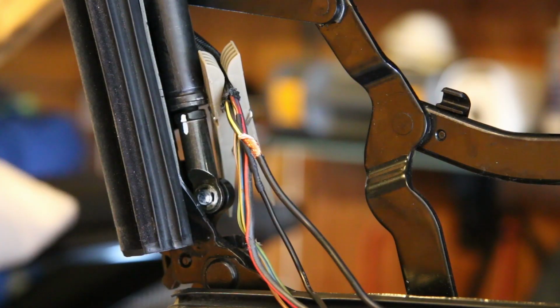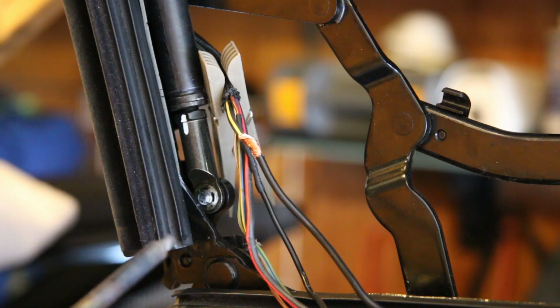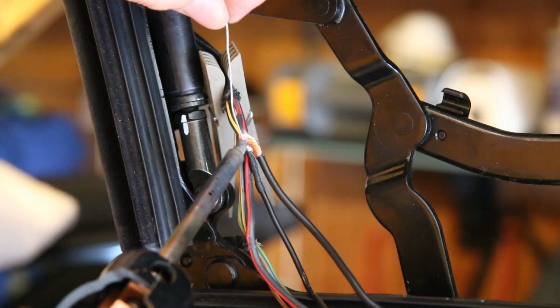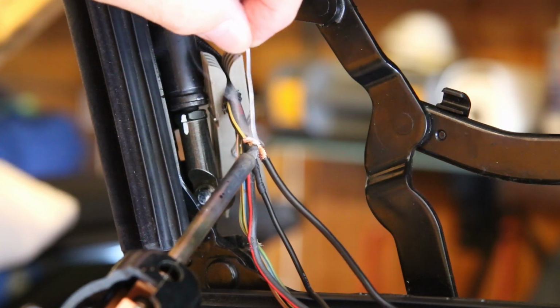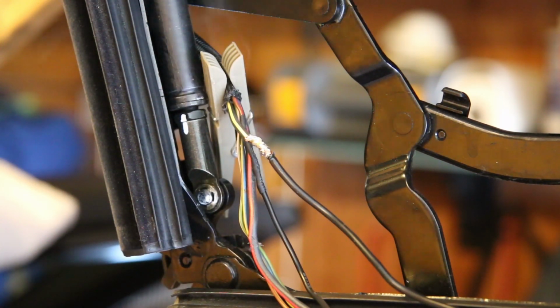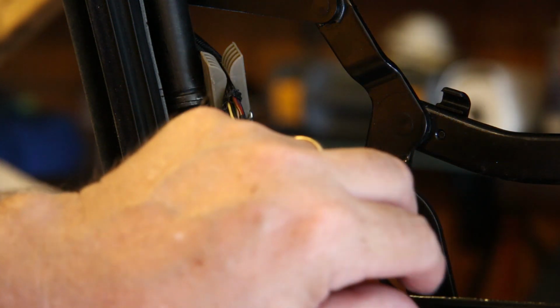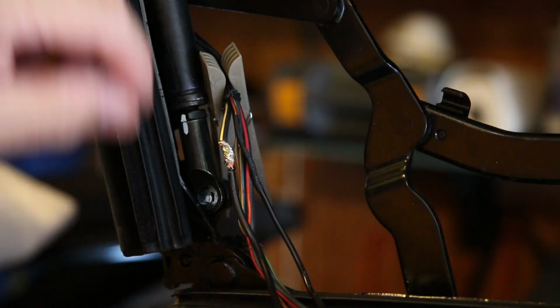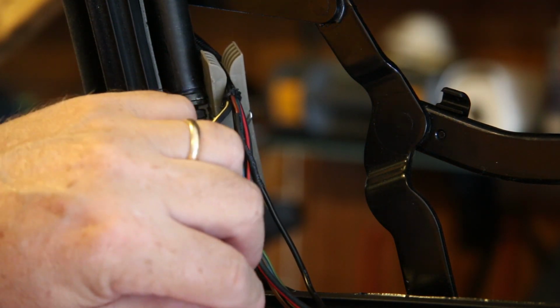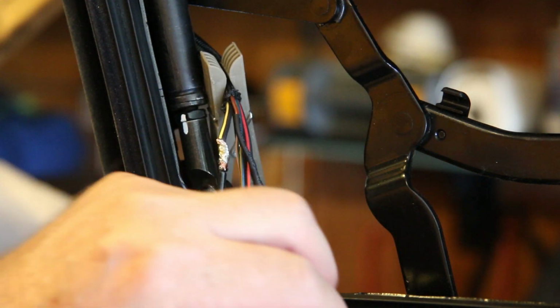continue. Now we're going to solder a section into a fatter wire, a wire that has a lot more gauge to it. So I'm using 14 gauge wire here. I'm a little concerned that BMW used a really fine gauge stranded wire that's obviously more flexible than what I found at AutoZone. I think it'll be okay, but if you can find wire that has very, very fine strands, it's going to be more resistant to bending and breaking.